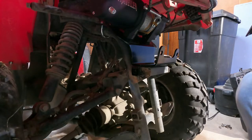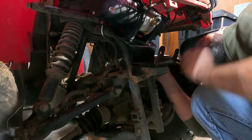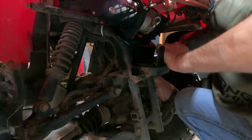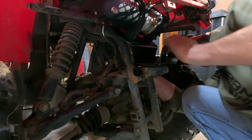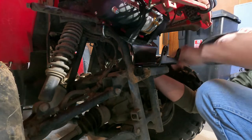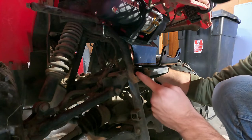One of the things you're going to want to do is keep everything loose — don't tighten anything up until you get your front bumper on. The reason for that is to make sure everything fits and fits good. I'm going to finish putting the two u-bolts up here and then we'll figure out the next part.